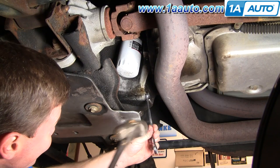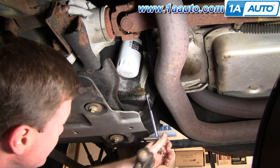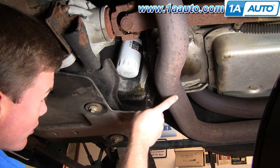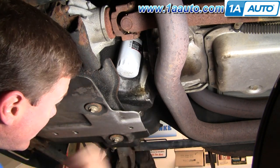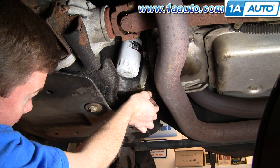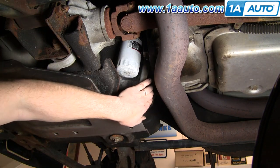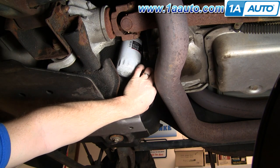I've got my 15-millimeter wrench, and at the dealer they must have put this on pretty tight because I'm using a hammer to just kind of get the wrench going a little bit. A longer socket and a ratchet handle would be fine. One note: I always do an oil change when the engine is warm, so in that case you just need to be careful. That pipe to the right of my hand is the exhaust pipe — if you're changing the oil on a warm engine, you need to be very careful of that exhaust pipe. The reason I do that is because when the oil is warmer it flows better, so you can get more of the old oil out.